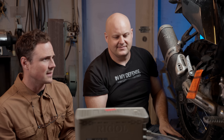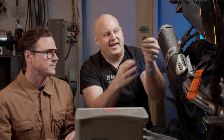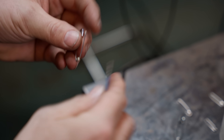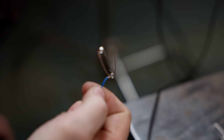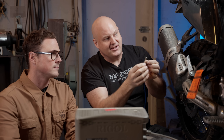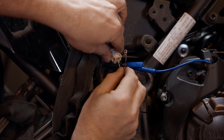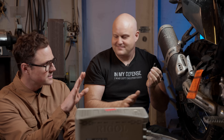How do I make a little test lead like that? We just take one of your random little safety pins lying around. If you want to connect a wire to it to make a remote measurement on your dash while you're riding, you just thread that piece of wire through the safety pin, give that a little pull, and you've got a connector. You can solder that, shrink tube it, cut the other end off if you like, and slide that carefully into the connector without damaging a single thing. And that doesn't mess with the connection — it's totally safe.